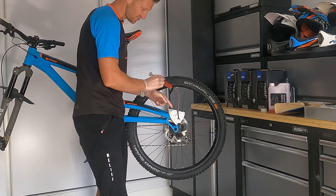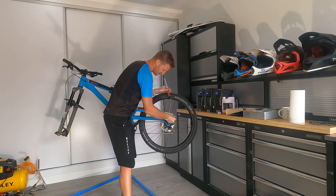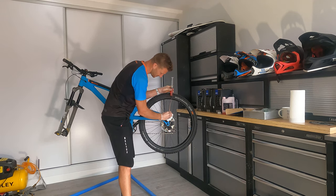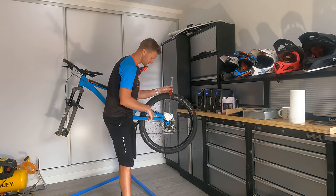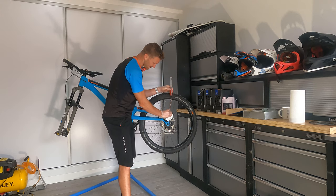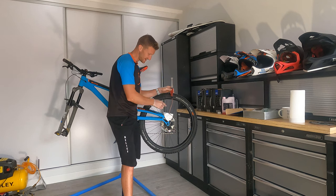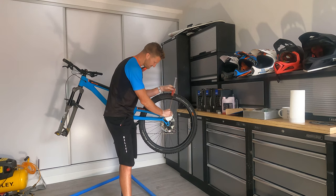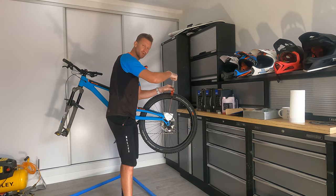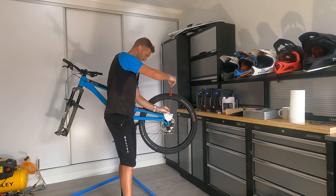Try desperately not to have any of this drip into the bike. Open up the screw just by turning the spanner a little bit, and as you can see we get a couple of bubbles already. Wait for these bubbles to come up — we want to get rid of those; I don't want to be pumping bubbles through the system. Give it a little shake if you like. Make sure that syringe stays on the nipple and doesn't come off, because remember we've got brake pads and disc in there — we don't want to spoil all of that. You can actually pull the syringe up to encourage the air to follow its natural path and go up to the top.